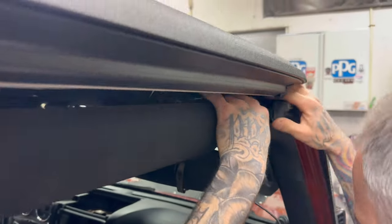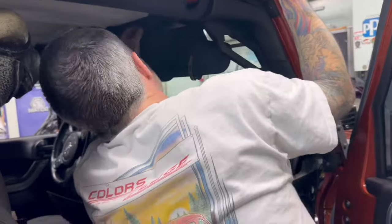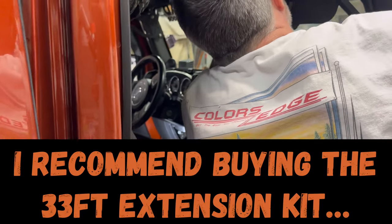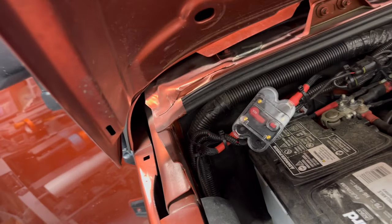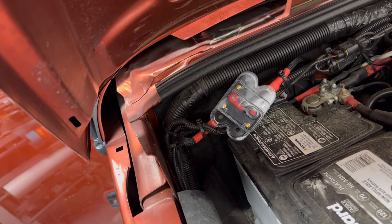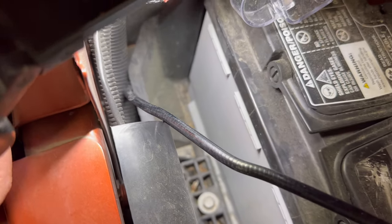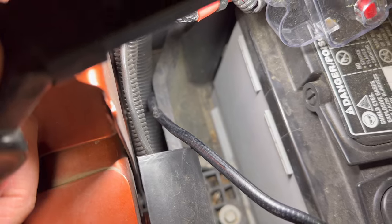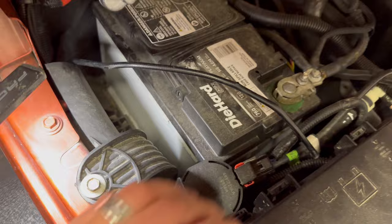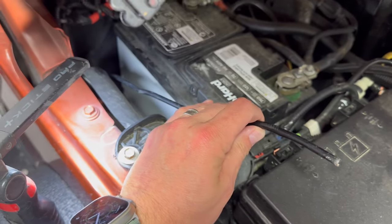When you're tucking in the A-pillar, we just kind of raise the soft top up a bit. Mike is using a new Snap-on tool. So I might have forgot to hit record. You can see Mike found a grommet that pushes through right behind that battery tray. He's running a fish wire first, then he's going to hook the camera wire and the power wire to it, and we'll just pull it through.